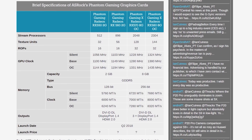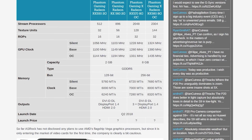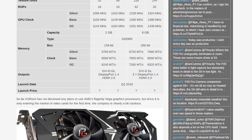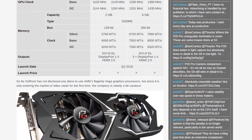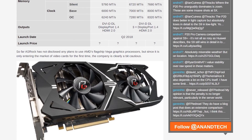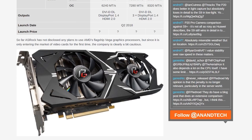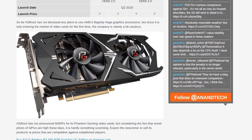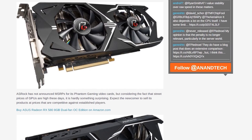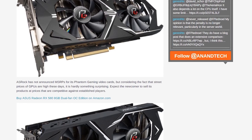That's how you access the factory overclock on all of these cards — they'll ship with AMD default clocks and a simple button in the utility will push those clocks up by 40 or 50 megahertz. ASRock has developed the coolers for all the graphics cards themselves. The RX 570 and 580 get a dual-fan solution with an aluminium radiator, copper base, and three heat pipes. The RX 560 and RX 550 use a smaller single-fan design with an aluminium radiator designed to be compatible with mini ITX systems. ASRock even mentions premium thermal grease, and there are DisplayPort, HDMI, and DVI outputs on these cards.